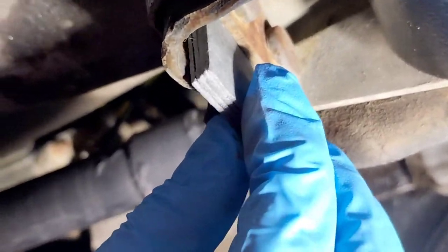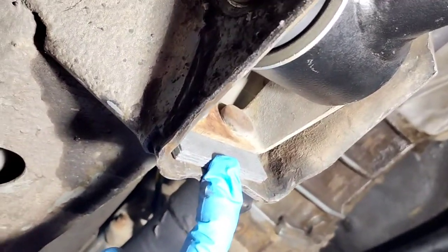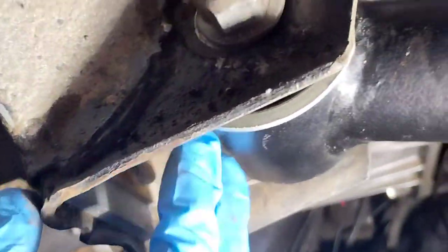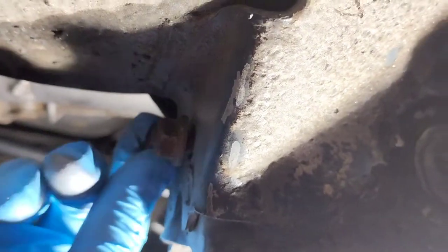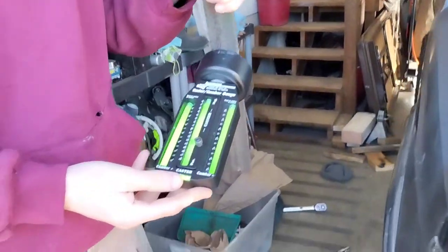There's a spot back here to put these shims. I've actually got enough to slip them up in there — give it one click on the ratchet strap on the passenger side. Okay, those shims are all the way in now. We've released both ratchet straps and it actually came back, so they're staying in by themselves instead of falling out. On the back side we've got a couple of bolts so we'll go ahead and tighten those up, and then we're going to recheck our caster.